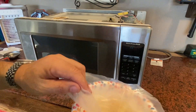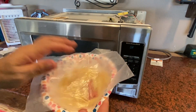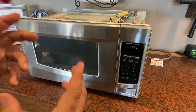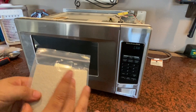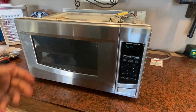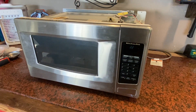We've got some steaming hot noodles and this microwave is back in operation. So that's it — you can easily repair these on your own. If you've got that magnetron failure, just don't forget to get your replacement mica card as well. You can cut it to fit into your existing machine, replace that magnetron, and you've saved another 10 years out of this microwave. I hope this video was helpful and this information was useful to you. As always, hope you have a great day.